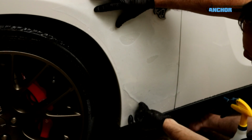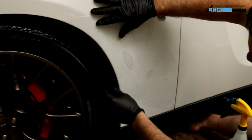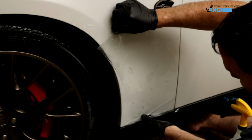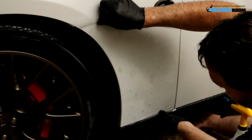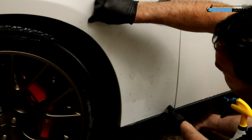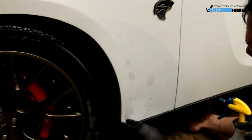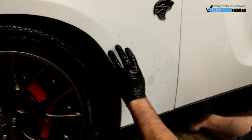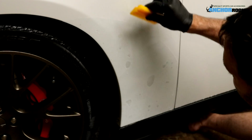The alignment points are very straightforward here. The bottom, the side, and the edge, they all have to align perfectly, and the slip obviously will give you the opportunity to reposition the material until it's in the right spot. Once it's there, quick tip to make your life a little easier, spray the outside of the material. It just gives something for the squeegee to slide across to make sure that we get everything out.